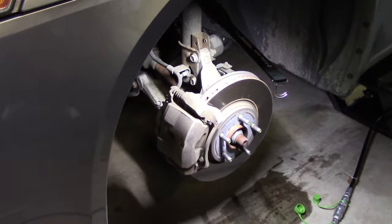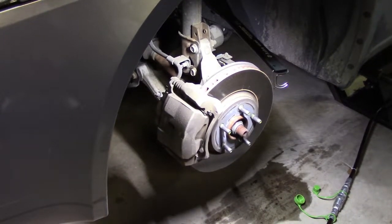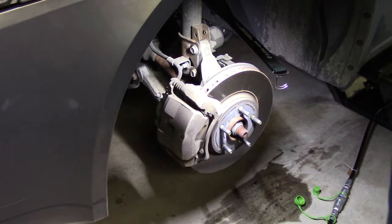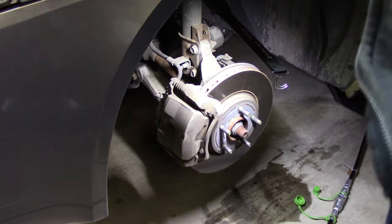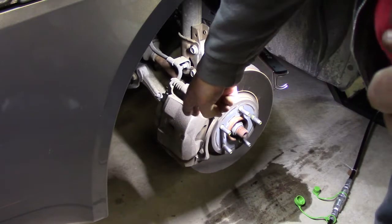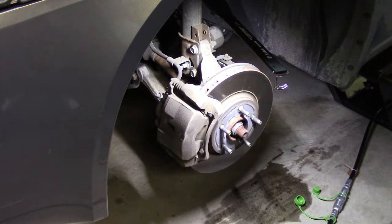It just so happens this particular automobile has disc all the way around, which makes it nice. I've gone ahead and pulled off all the tires, and I've looked, and actually the rear ones look like they're in good shape. The majority of your braking force is always up front, about 70% of it, and those pads are looking a little worn. If I did a fairly firm or hard stop, I could feel a little pulsation in the front. So I don't know about the rotors yet.